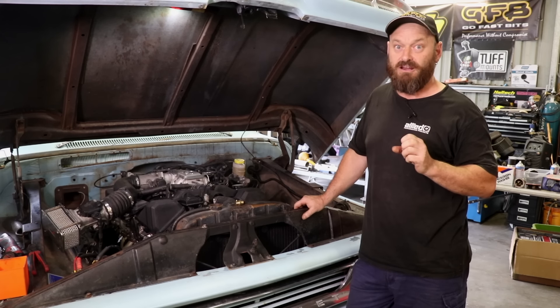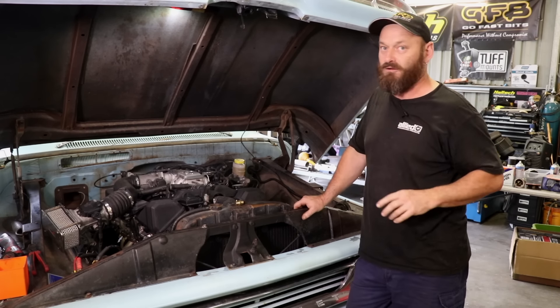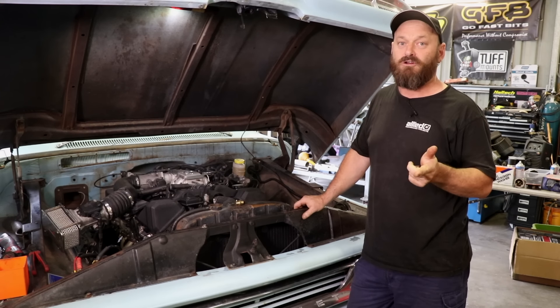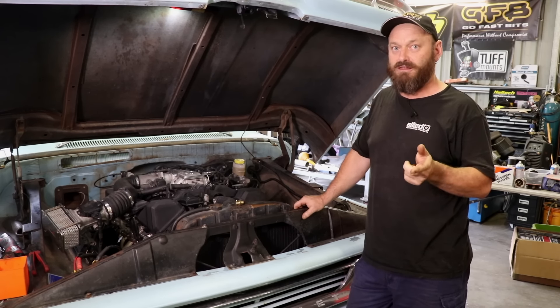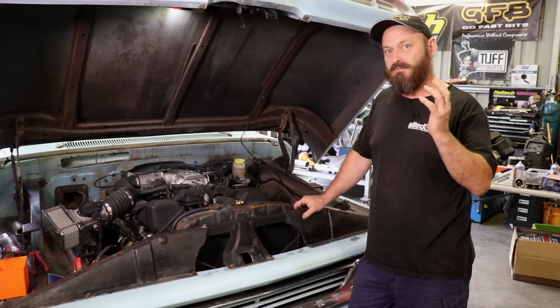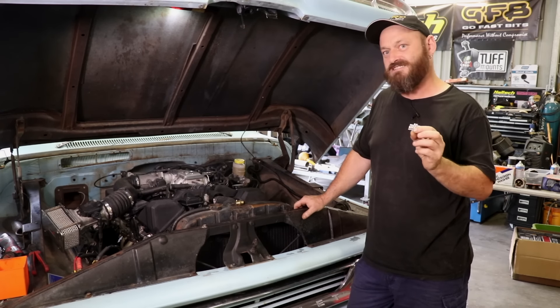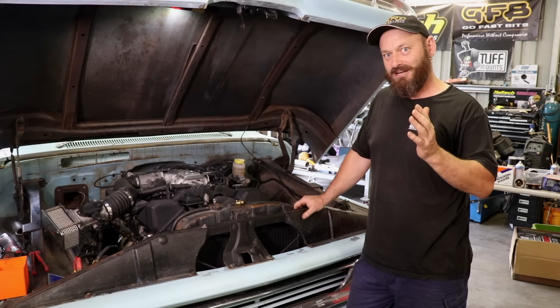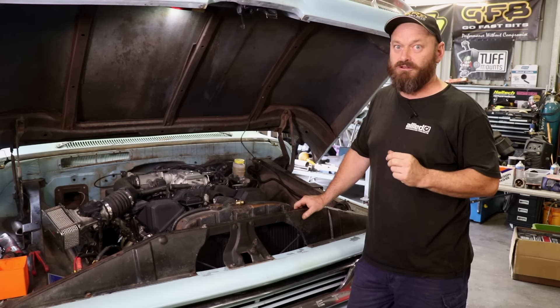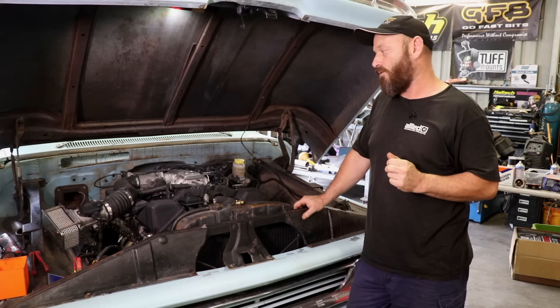Some people just switch the fan on when you turn the ignition on — that's how this car has been set up. Big problem with that: those fans are not built to run flat out all the time, you'll just wear them out and they will stop working. They also make a lot of noise, and it impedes the process of bringing the engine up to temperature. So yes, you should control the thermo fan — it should only be turned on when it's required.